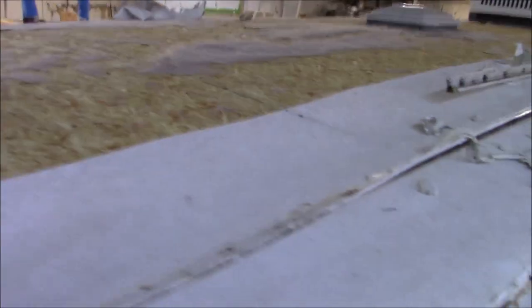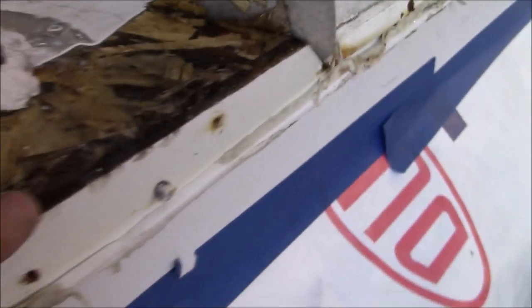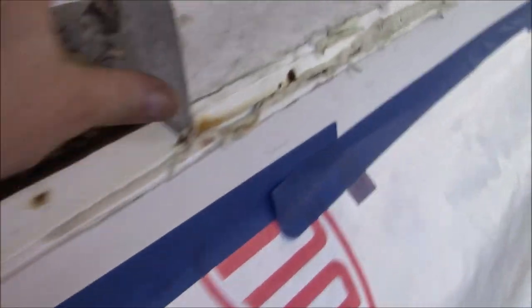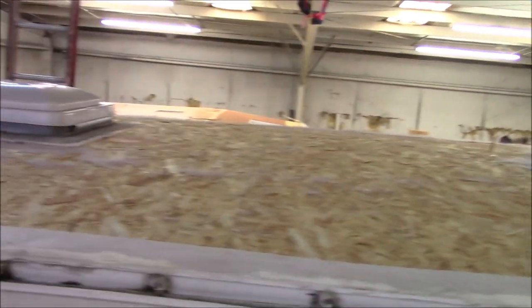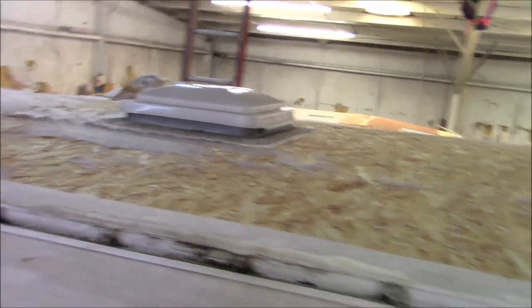Overall, we don't see very much rot in the center portion over there, but look along here. This is where the termination bar was, or your gutter rail — you can see all that rust in there. We've got a little bit of moisture in here, so we're gonna investigate that. This was the rail right here — see all the rust on the back. This is aluminum, so it kind of tells you something's going on behind there. We'll get that AC freed up, but we'd like to try to get the roof off first to see what's going on. Just looking at all that fleece, I know it's gonna have to get some sort of re-decking.